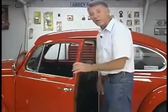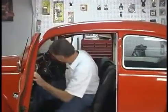The first problem we're going to deal with is this: you go out and get in your Volkswagen, all set to go someplace, you hit the key and nothing happens. Where do you start? Well, you might think maybe my starter's bad and go buy an expensive starter, or maybe my generator went bad. But before we can diagnose or check any of those components, we're going to have to have a hot battery — a battery that's in good shape.